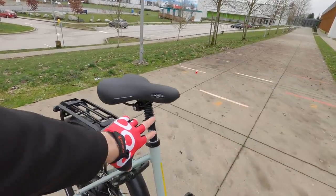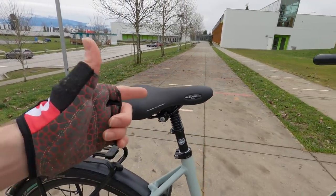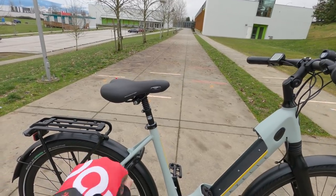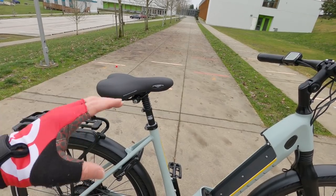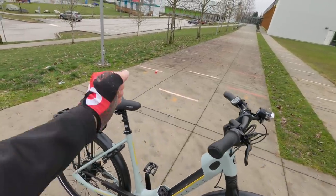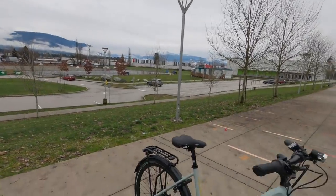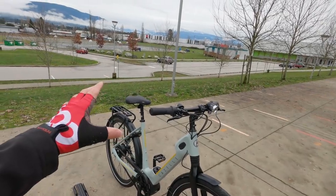You've got a suspension seat post right here, only 40 millimeters of travel, Postmoderne. This thing has preload adjust in the base. I think you just use like a little hex wrench. You can twist to the right or the left. There is a little bit of stiction, which means it doesn't slide like perfectly smoothly buttery. It's a little bit more, and it kind of jerks into position or out of position, especially if it's cooler. And today is a cooler morning, so you know, that's the case. It warms up a little bit over time, and when you set it for your body weight, it works great.